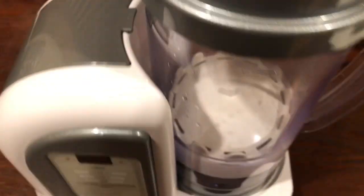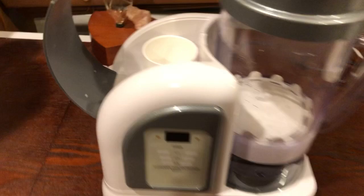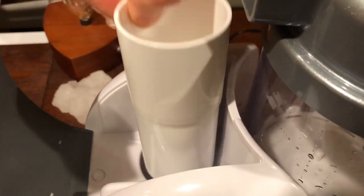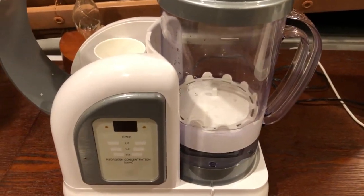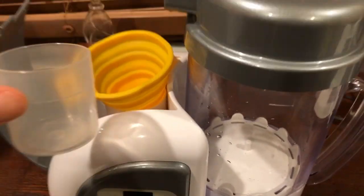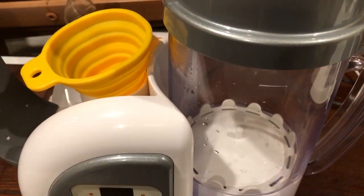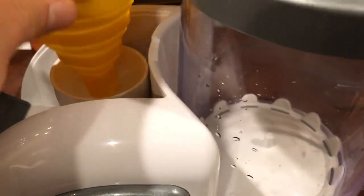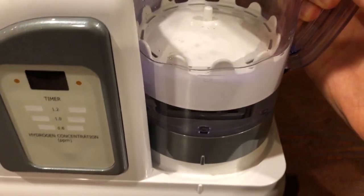Then unplug power to it — you don't want any power to it when you're just setting it up brand new. The very next thing is to put water in it. Pour the water right in here. If you spill it anywhere, wipe it up immediately, and don't try to put water in it if the filter is not in there. Make sure the filter is in there. When it's completely dry it takes 100 milliliters. I usually use a little funnel and a pre-measured cup. Pour slowly 50 milliliters, let it go through the filter, then do it one more time. The water might be a reddish color — that's totally normal.